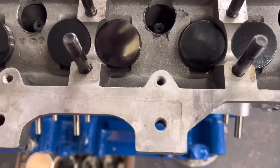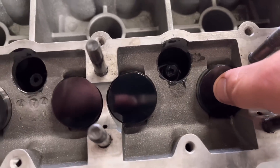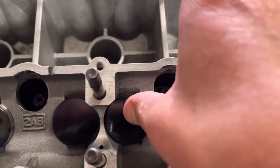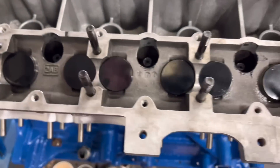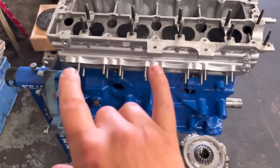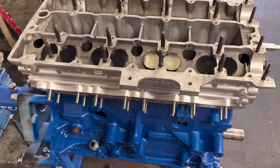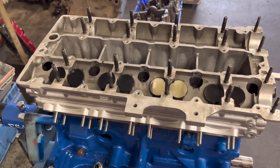As I say, as long as you go nice and steady you'll be absolutely fine. Now these are in here with some oil and if we press these down, you just make sure that they're all nice and squidgy. What will happen is as soon as you get the oil pressure up and fire the engine up, within a split second these will jack out with oil and that will be absolutely fine. These genuine ones don't really give any trouble whatsoever. So we're just going to get the other eight done, get them in, and then we can get the camshafts in.